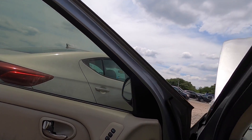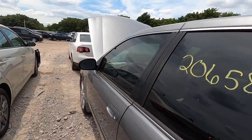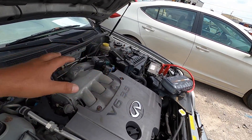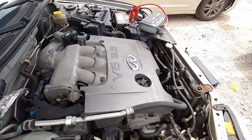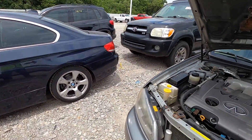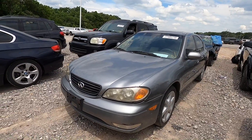Let's see what's in the trunk — it's empty. It is hot out here today. I thought about hitting the buy-it-now, but run-and-drive, guys — you really got to come look at this stuff in person. It does have a misfire — it could be something as simple as replacing the spark plugs, though I'll have to remove a lot of stuff to get to the rear spark plugs with the intake plenum running over the valve cover. At $650, it's priced right. We did the same thing with an Avenger not long ago — once we did the tune-up it ran like a brand new car. Not interested right now, but maybe you are.